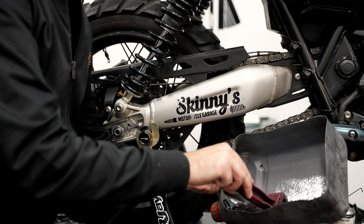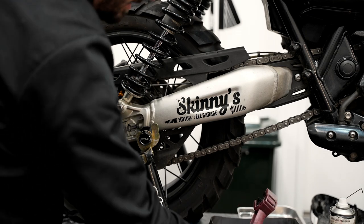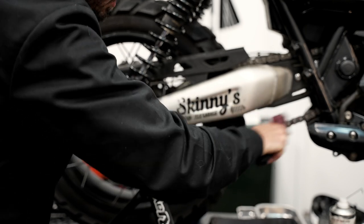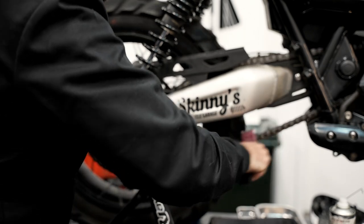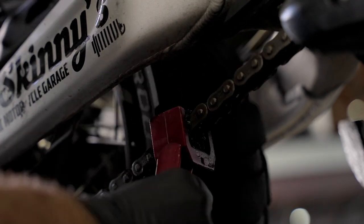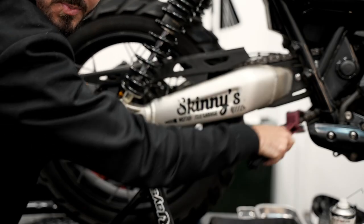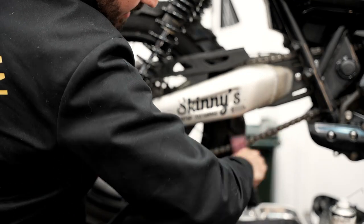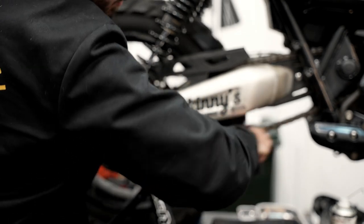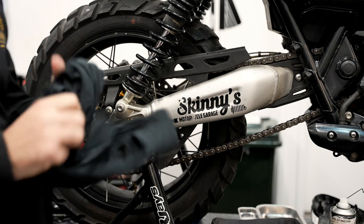Get the brush soaking in some of that kerosene or whatever you're going to clean it with. I put the container underneath so it's catching all the drips — you can see it's probably dripping stuff everywhere. Then just go through cleaning the chain. You can get these super handy chain cleaning brushes online for like $12 Australian — probably even cheaper in the States. Give it a clean top and bottom so you're actually getting in between the links where they move. Once that's done, just give it a bit of a wipe with a cloth or rag.